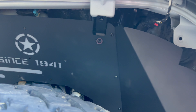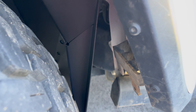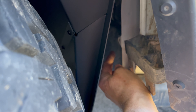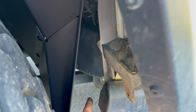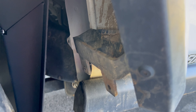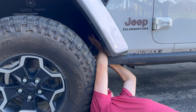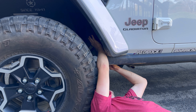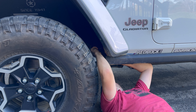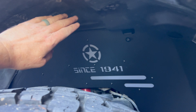Get it up in there extremely loose. There's a hole down there that has to bolt in — on your Jeep there's one on the bottom and one up top, and it's a pain. You'll want to push real hard on your fender liner to get that bolt started so you can get the nut behind it, then go ahead and tighten up all of your bolts to secure the whole fender liner.